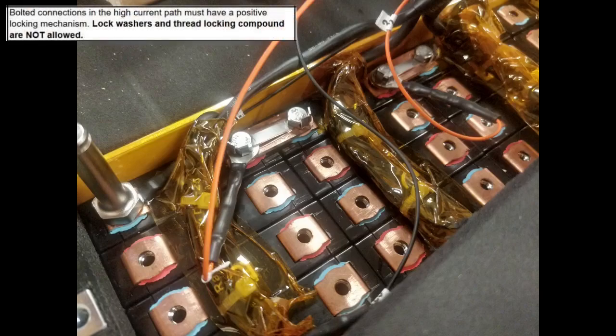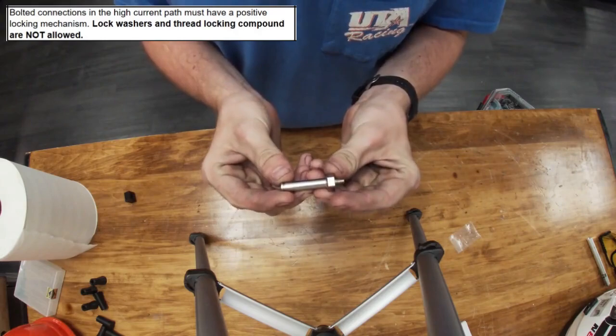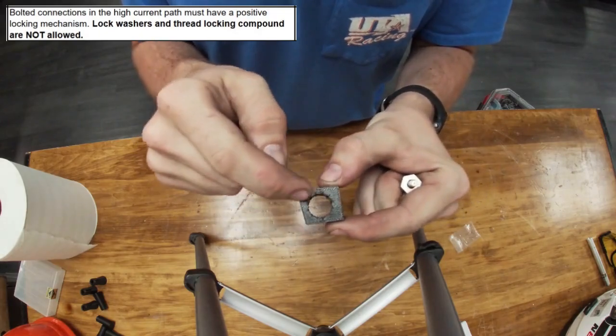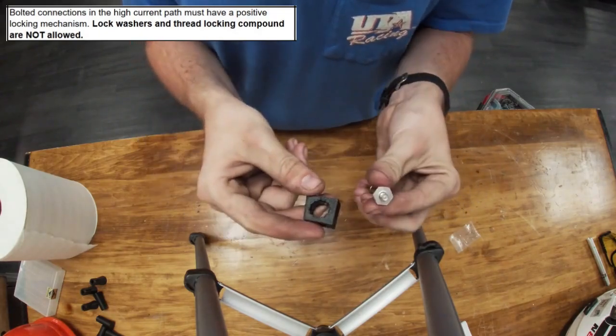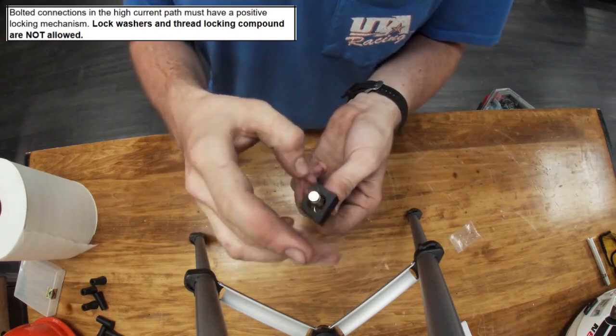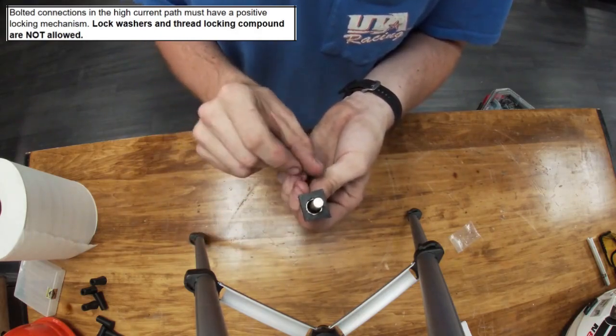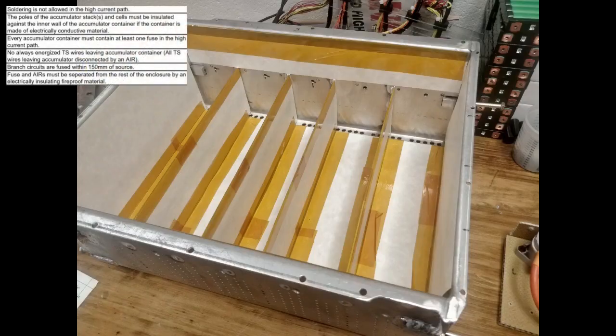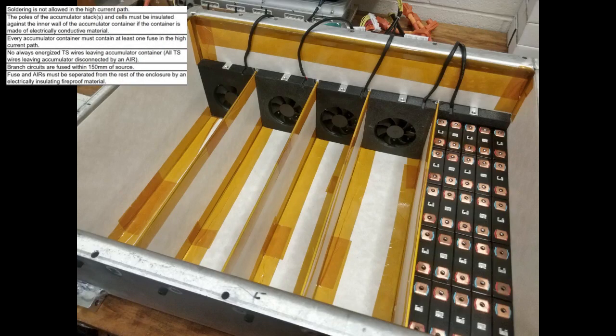For the cell-to-cell bus bars, there are metal tab washers which go under the bolts. After the bolts are torqued to spec, the tabs are bent up around the bolt heads to prevent them loosening. For our segment-to-segment connections, we use custom-machined radlock pins, and to prevent them from loosening, we use a plastic piece with a hexagonal pattern that fits over the hex in the radlock. When you torque the radlock to spec, you simply place this plastic piece over it, and it is just the right thickness and width to sit against the adjacent plastic piece or wall to prevent loosening. The insulation on the inside of the accumulator was applied before cell assembly. Most of it is a Kevlar aramid fabric for insulation, and the edges are sealed with Kapton tape as listed in our ESF.